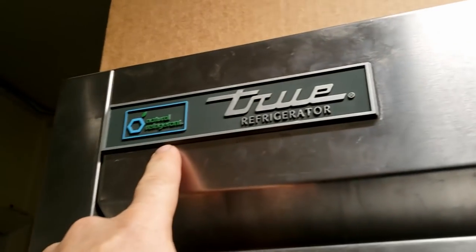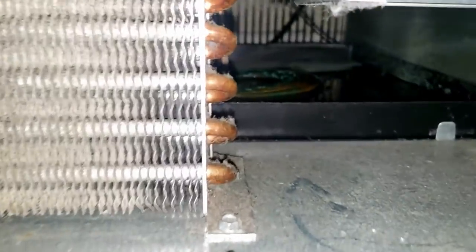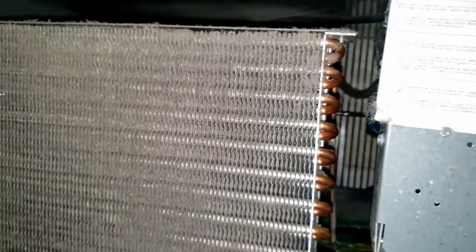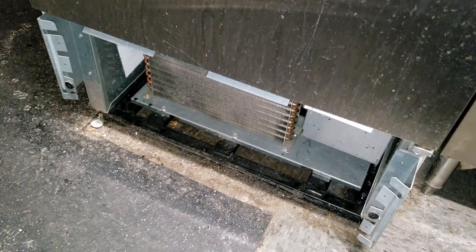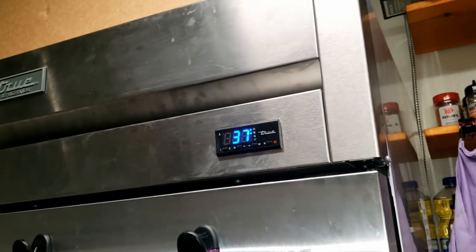We've got another True natural refrigerant cooler. The coil is really freezing up - it's been doing it since June. It worked for maybe a month and then they had to unplug it, and basically it works again for a while. Looks like our seals are in need of replacing - a little dirty. There's a little bit of water down in the pan. The coils look a little ratty. I'm going to brush the coil off, check the system for leaks, because that tends to happen. I notice the condenser coil doesn't feel very warm.